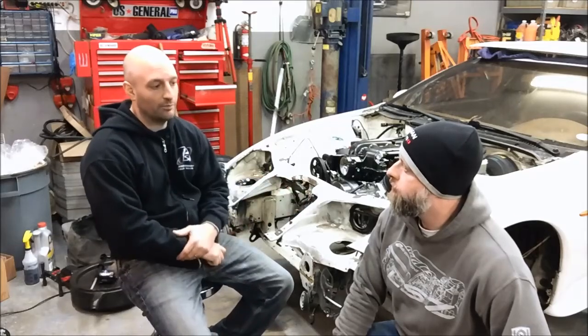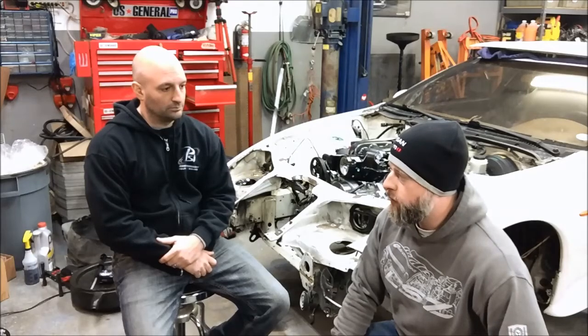Really, that's the major stuff you have to worry about, other than the fact that one's 58X versus 24X, which we cover in a different video. From a cylinder head perspective, everything Gen 4 — again, leaving the LS2 out of this discussion — all Gen 4 engines that are six liters and up displacement-wise will have a rectangular port head like an LS3.